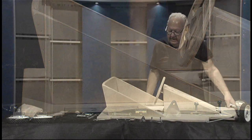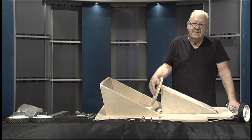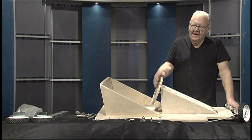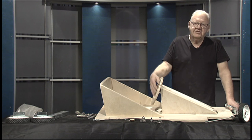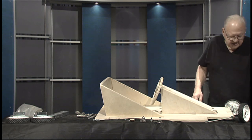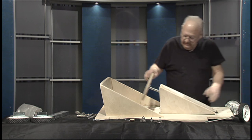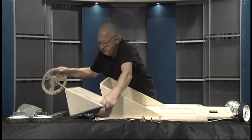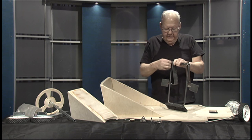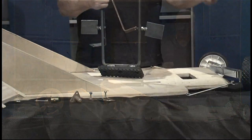Our brake system — the go kit assembly shows different brake systems — but St. Albert has decided that we don't want children taking their hands off the wheels to apply the brakes. We found that other methods of braking are extremely hard on tires because they wear tires flat when they lock up the wheels. We came up with this braking system, which we are very happy with and it works well. I'm just going to remove the cowl and wheel and show you how it works. It's very similar to snow cruisers that kids have where they jump on the brake and the thing digs into the snow below the sled.